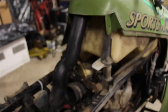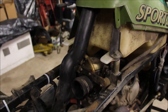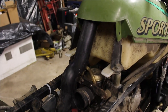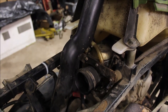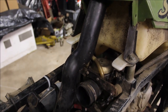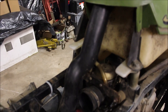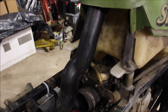This vacuum-operated carburetor is very temperamental when it's not getting the right airflow — cracks in your hoses, wrong style hose, leaks in your airbox. This particular ATV was sitting for about six months to a year, and when I got it the carb was all gummed up from the gas. Some guys say you should be able to get away with a good cleaning on the carb, but I don't buy into that. I usually get a carb rebuild kit because you get nice clean jets and the fuel flows a lot smoother than through an older jet that may look clean but could be a little crusty.